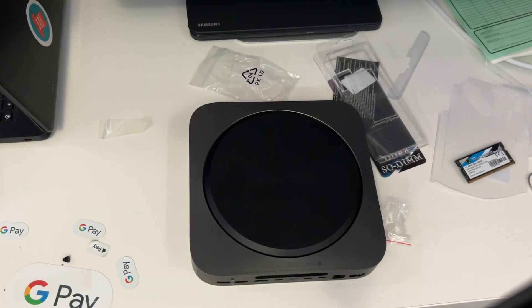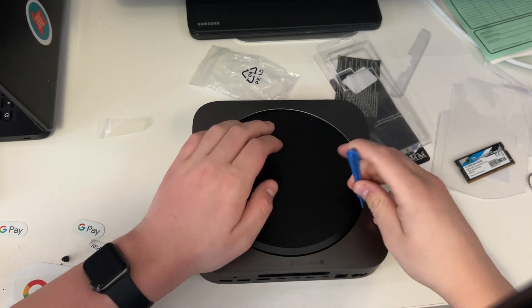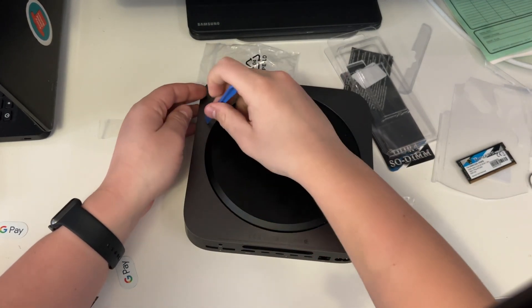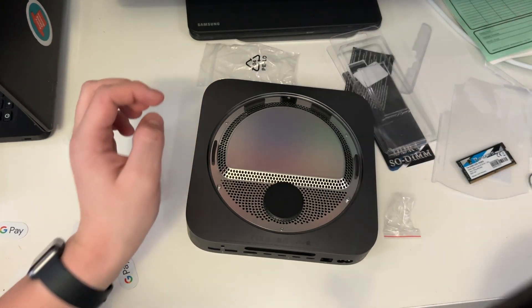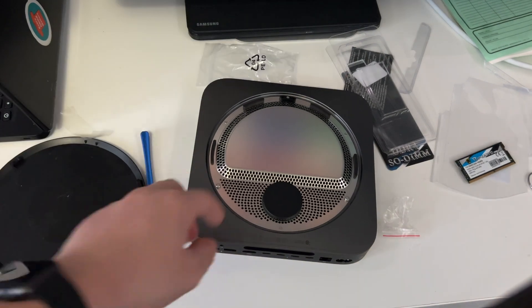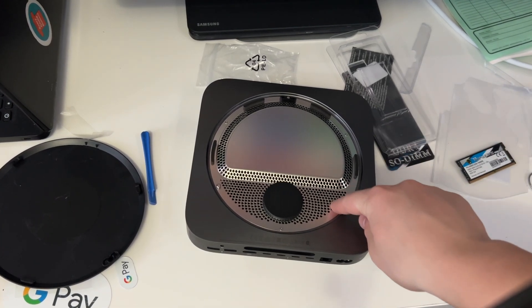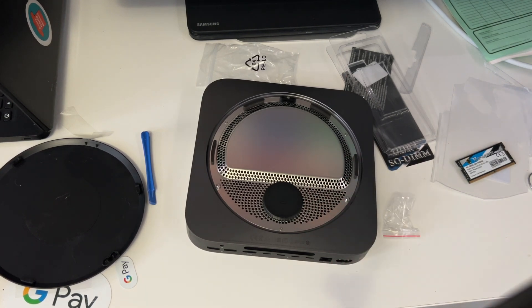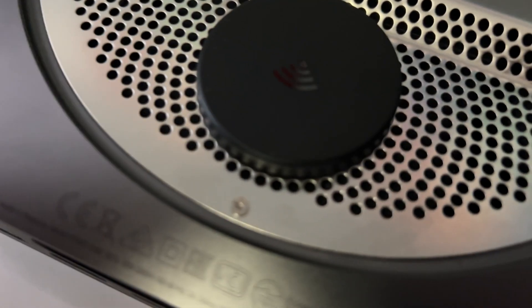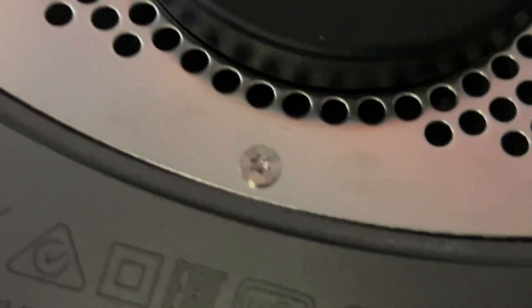Just a warning — this is not a tutorial, this is just me screwing around. You pick up the antenna cover like this — there we go. It's actually pretty easy. All I need to do is take off this antenna plate. If you're following along at home — as you shouldn't be, because this is not a tutorial — just make sure you do not damage the internal antenna cable. My friend did this on his M1 Mac Mini and he needed to buy a whole new antenna for it. And of course, Apple has to use those stupid security bits with the little thing in the middle, preventing you from using basically any other screwdriver except one that specifically has a hole in the middle of it.